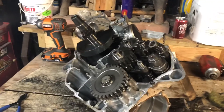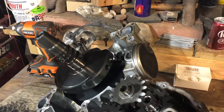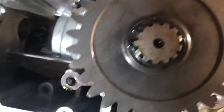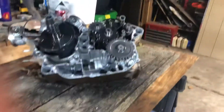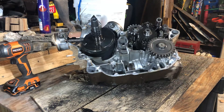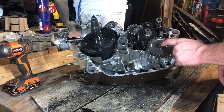The irony is you can see the slack and feel it, but you still have to take cylinders off, heads, valve covers, timing chain — split the case, clutch pieces, everything. Now we have a little C-clip retaining this bevel gear sprocket. We're going to start taking this off — it could be a faulty bearing worn prematurely or the retaining nut backed off on the end of the bevel gear shaft.